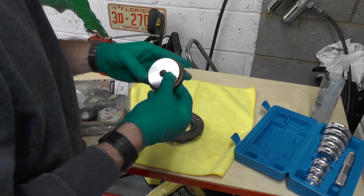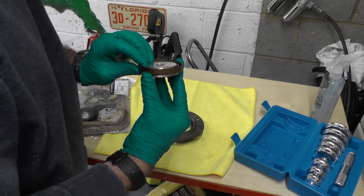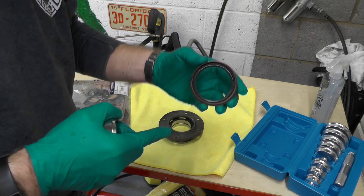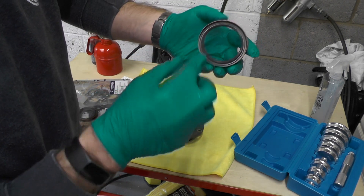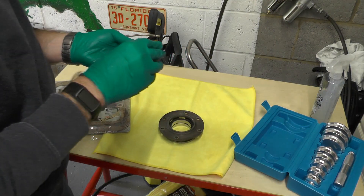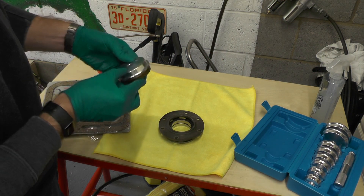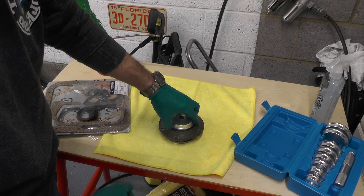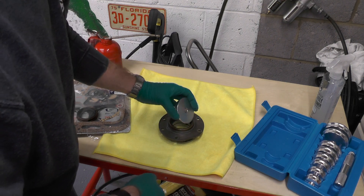In order to do that I bought this set — we need to find the right one. I need to be careful here as well because that ring is desperate to come out of there. There's a metal ring that goes around on the inside and that's desperate to pop out if we let it. Let's find the right size — let's try the 65. Actually I think we can go even bigger — this is a 72 mil, and that should spread the load. If we put it on there it should allow us when we knock it down to spread the load evenly, so we're going to use it that way up rather than that way up.